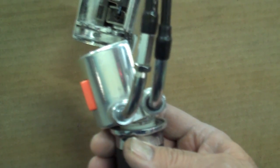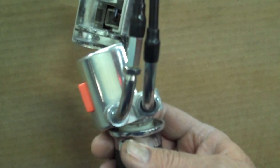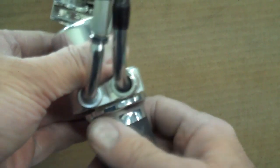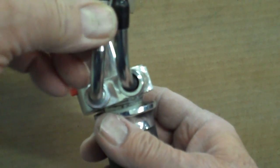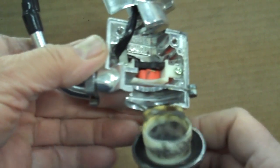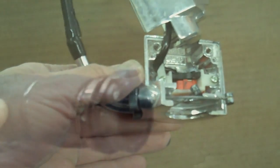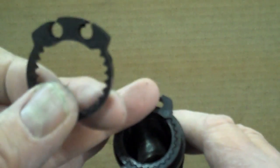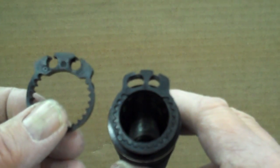I'm going to replace the grip with our Avon grips. If you're going to leave your stock grip, just skip this section. Adjust the adjusting screw all the way to give you the most play in the throttle possible, then rotate the throttle tube up out of the housing and pull the cable over to release it. Release both cables and we'll put the new throttle on. Go ahead and glue the proper throttle cam in place on your throttle tube — the narrow one is for the Honda, and the wider one is for all other bikes. Make sure you use the skinnier one. Let it cure as the directions say, then we'll continue.